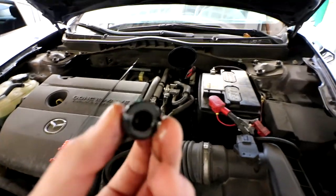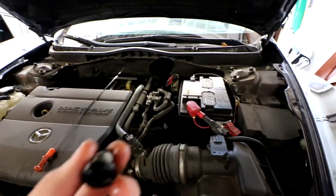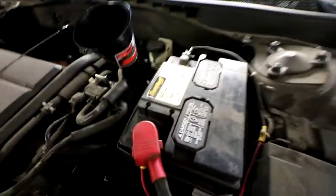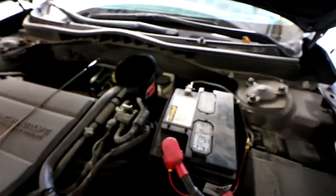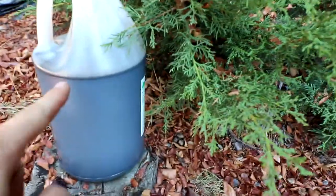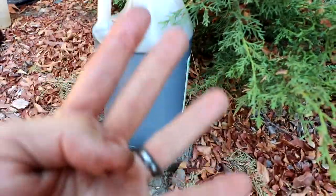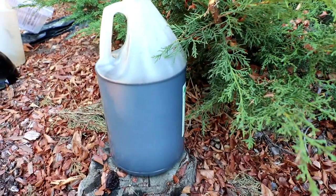So just give that a quick check. Once you're done draining — I let it drain for about four or five minutes — then I screw the plug back in with the eight millimeter. Make sure you tighten it up to spec; I'll put the correct torque specs in the description below. I have the dipstick pulled out so it drains better. When it comes time to fill, it's really important to have a really long funnel like this — it fits in there nicely and makes it easy to pour the bottles in versus trying to aim with a smaller funnel that isn't going to clear all these wires. So that's about three and three-quarters quarts because this is a one-gallon container — one gallon is four quarts — so I know I'm going to need to put at least three and a half quarts back into my automatic transmission.